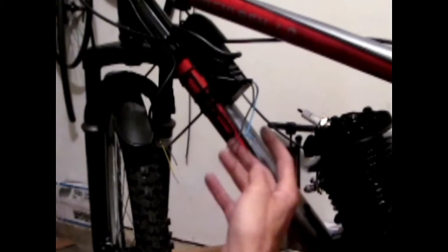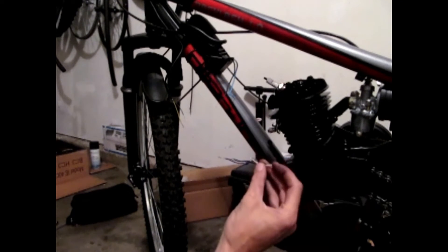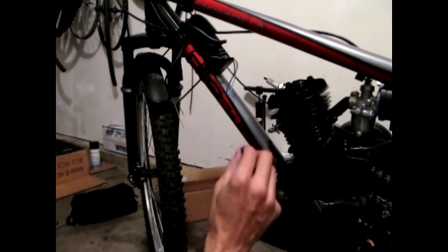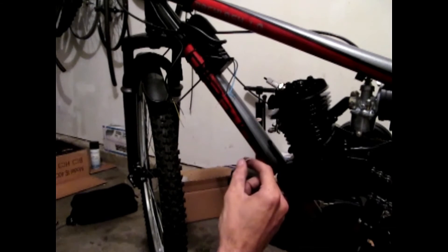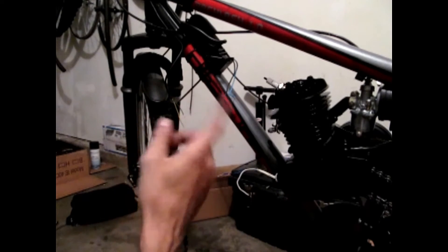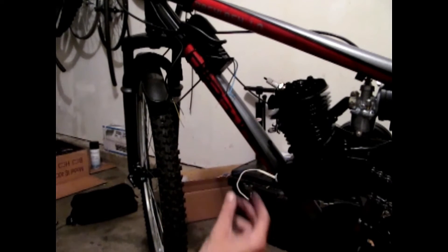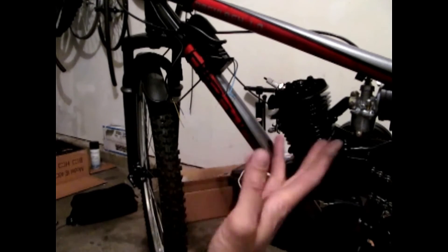I got these wires all cut and done up. The white wires are six volts power. If you wanted a light charged, what I would do is hook this up to a battery for a trickle charge — some source of battery — and have your light run off your battery with its own switch, with this just being the charger. You also want to put a charge controller in there, because this is always going to be six volts, and if you overcharge your battery — boom.